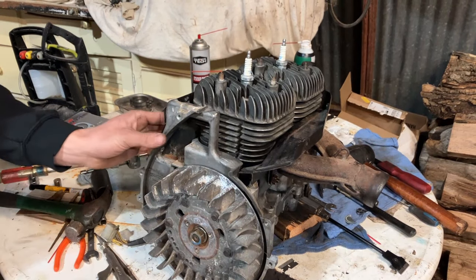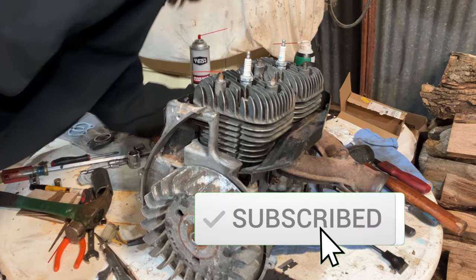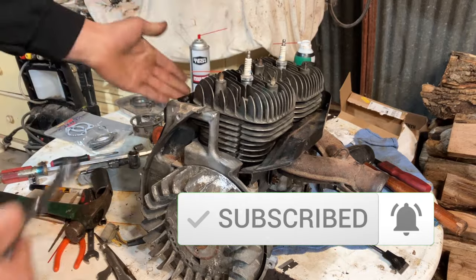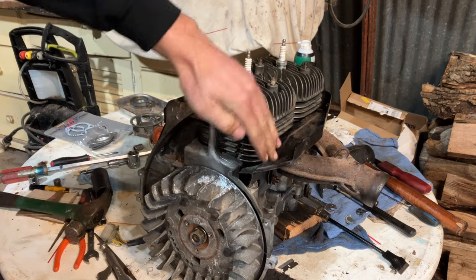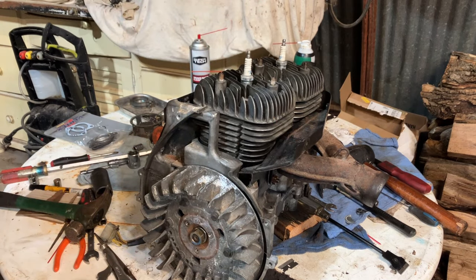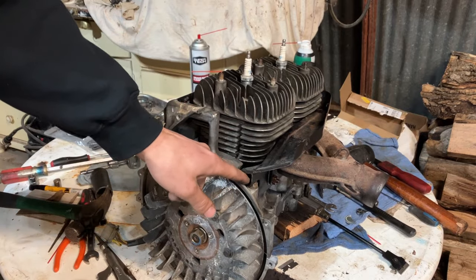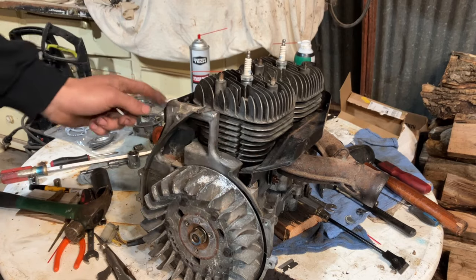We're making sure that the backside connected properly with that one fastener where the two fan shrouds meet. The intake side is going to go behind it with the threaded portion. The exhaust shield is going to go on top of that with a bolt through it. So this piece can go on obviously before these, because then you can't tighten the bolt if you put it on after these are on. It's not going to happen.